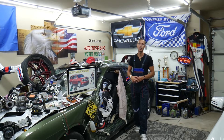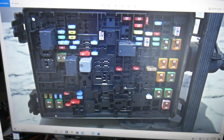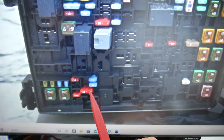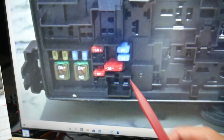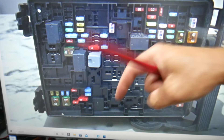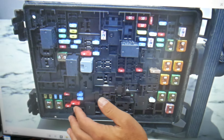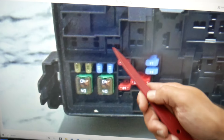Here's what you need to check now. You may have all the fuses or some depending on which headlight option you have. We will need to check up to three different fuses. The first one you will need to check is fuse number 95 — these are double 10-amp fuses, that's a micro 3 blade fuse — it's right here. This is super hard to find and could be overpriced, so we'll put a link in the description where you can get it. Then we have fuse 121 and fuse 122 in that section. These two fuses will need to be checked as well.